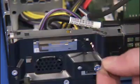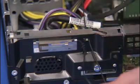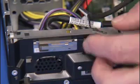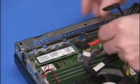Pass the front antenna cable back into the unit through its access hole. Rout the front antenna cable back into the cable guides on the front EMI bracket.